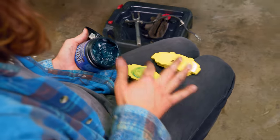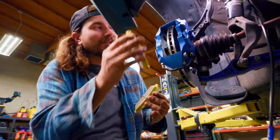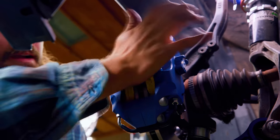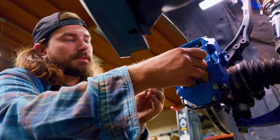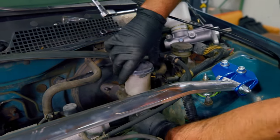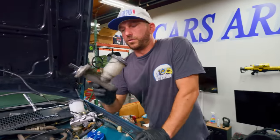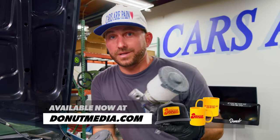In true Spoon fashion, the brake pads are yellow — blue and yellow baby. While I work on the brakes, shop daddy Adam is going to replace the master cylinder. This is the old brake master cylinder and all it does is send fluid front and back when you press the brake. The new one's bigger since we've got more fluid, bigger brakes, and discs going in the back. We need this one from newer Integras — it's a direct bolt-on, easy swap.